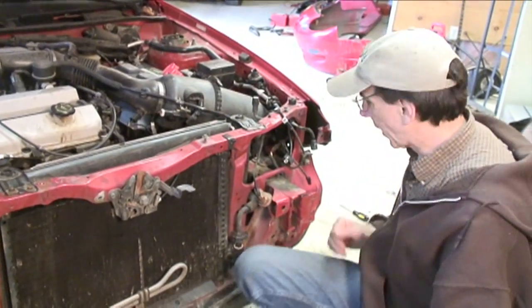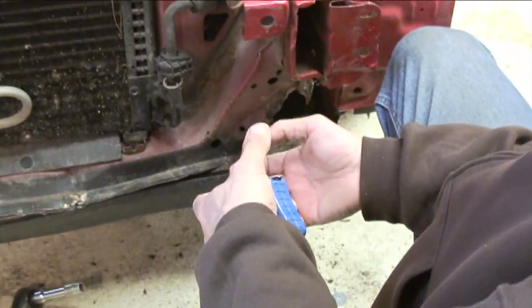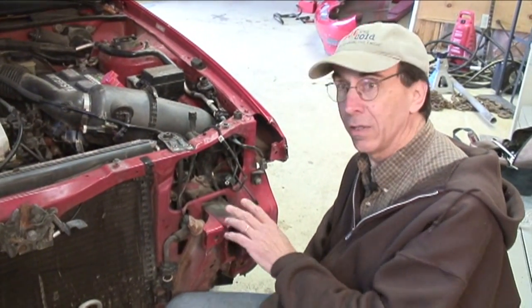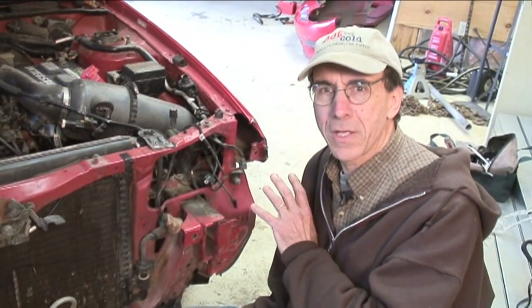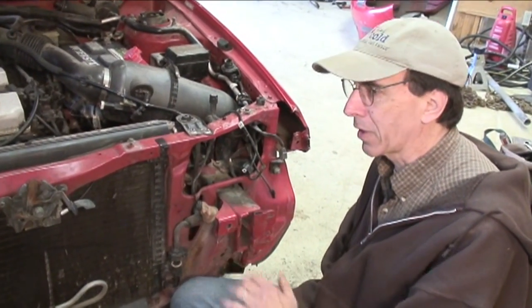This actually lifted up. What I was doing was trying to lift this piece, but this down here was bent and tucked under slightly, so when I pulled it out, everything lifted back up. You really have to understand what's going on with the structure. I could have pulled here and maybe got that to come up, but nothing was moving very well. It's a fine line between it working and you tearing a piece of steel — at that point you wind up at a body shop doing a lot of welding. This was not real bad, so I'm comfortable with what we're going to do here.